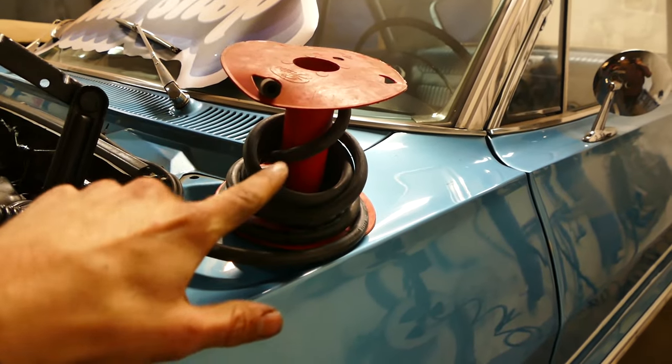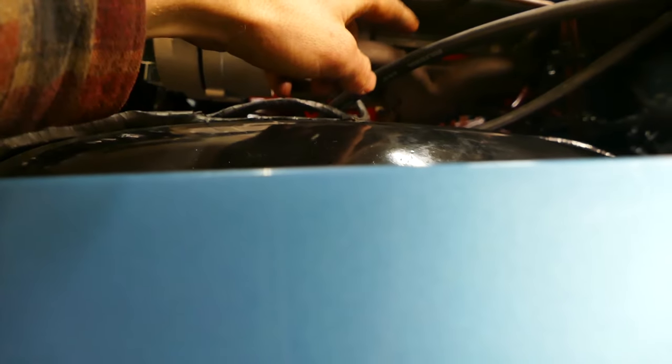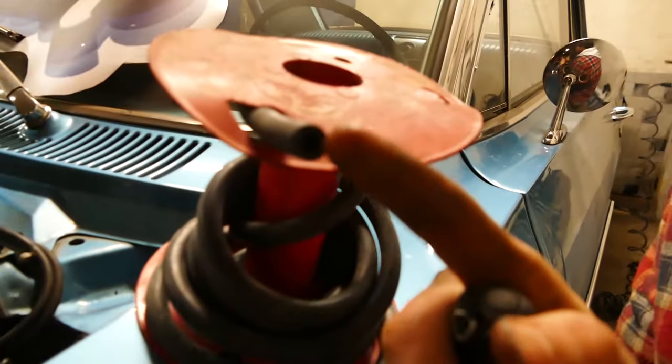Here's the trick you want to do: you got some free piece of fuel line, right? You're just going to stick that fuel line into the cylinder, then up here in the rocker area you put a finger on it. Then when you turn the engine, when it hits top dead center on the compression stroke, the hose is going to pop up and then you let off the key. Then you go out and check your harmonic balancer and it should be pretty close, and you can fine-adjust the last bit on the harmonic balancer using the bolt to turn the engine back or forward.